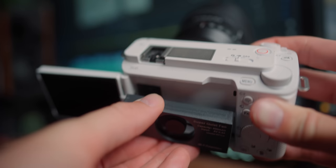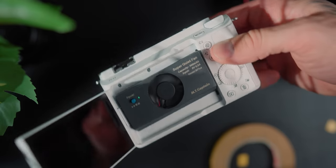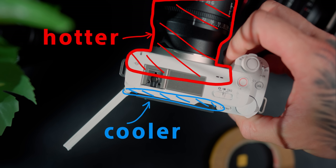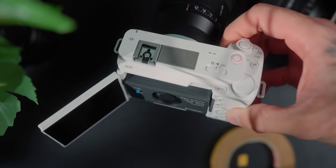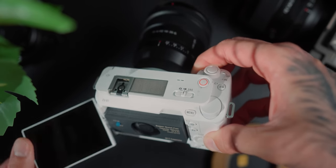What I did notice is that when I touched the back of the camera it was nice and cool — it worked quite well. But it was the top of the camera and the front of the lens that actually started heating up. So when it comes to heat dissipation it can't dissipate that heat around this smaller body, whereas the FX3 and FX30 obviously have exhaust fans and the heat can escape — and they are bigger bodies as well. So even though this is a little bit of a fix and does give you longer record times, the heat still can't escape from the body.